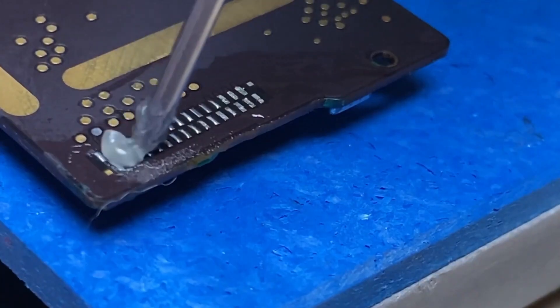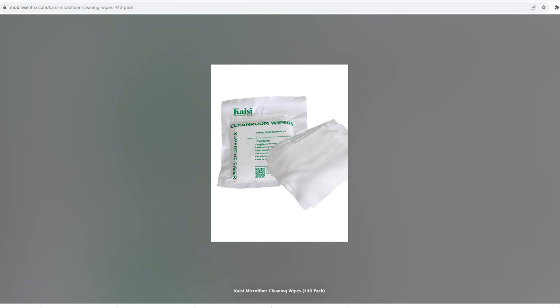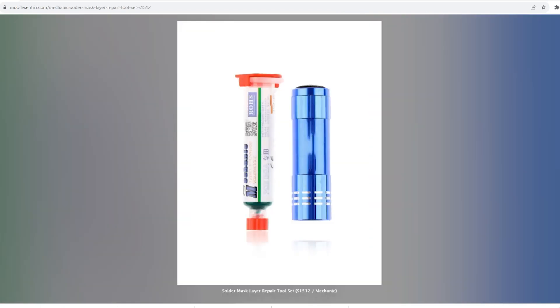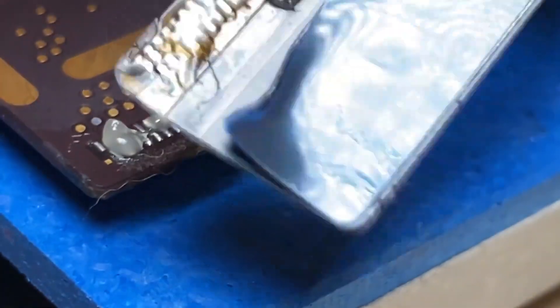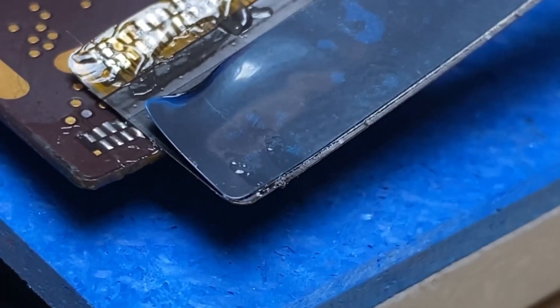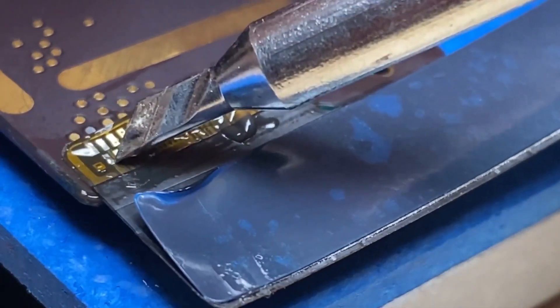Probably the biggest area where soldering is most needed is on the iPads. Here are the different products that you will need apart from the soldering iron and the solder itself: flux, wick, a cleaning brush, microfiber cloths, isopropyl alcohol or other flux cleaners. To assist in or protect the repairs, you may need Kapton tape and potentially solder UV mask. Flux is designed to act as a shield to clean and prevent oxidation from occurring while the solder is at its melting temperature. As solder is exposed to oxygen it starts to oxidize, and to prevent that oxidation, flux is required. One side effect is it helps the solder flow between surfaces that it will stick to.